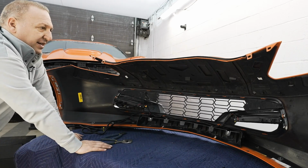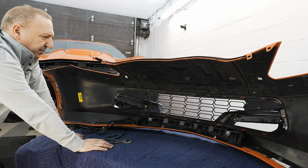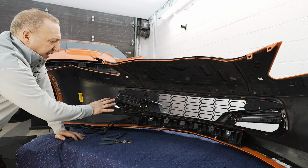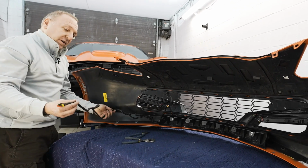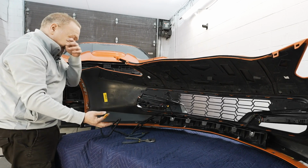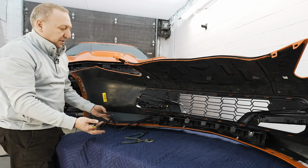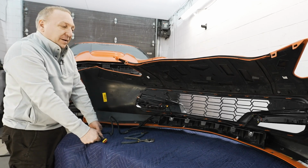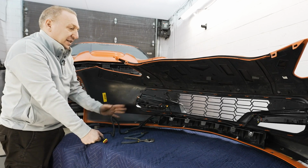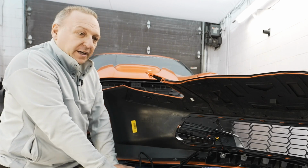Basically, I want to make sure my next technician that works on the car is not surprised or alarmed by it. So it's pretty obvious. We have LED lights, we have a clean harness, there's 1 connector. This is the access so that when they do pull out the bumper for the first time, they have some room to play with and they're not surprised or tearing something apart. So that's the whole idea behind this. Plus, it's a lot easier to troubleshoot. God forbid something were to happen later on where you need to service these. Anybody could hop in, check each connection and make sure everything's A-OK and obvious.